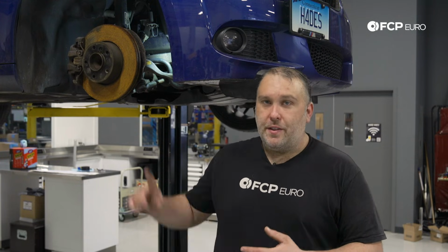So we've already assessed the damage on this car, and honestly, it just looks like a tie rod has been affected, but there's a lot of high mileage components on here, and we're gonna go ahead and replace actually several other things: control arms, wheel bearing, also the wheel carrier or steering knuckle, just because it is an aluminum piece and it's not really worth taking the risk since it's relatively cheap. So we're gonna have several different DIY videos addressing those repairs. So we'll go ahead and link that in the description if you're interested in seeing the follow-up on this.